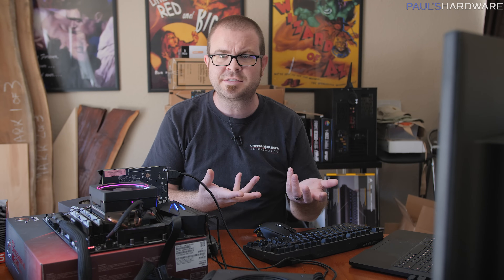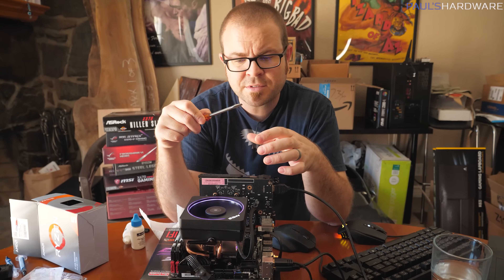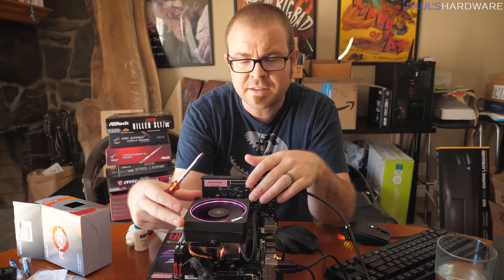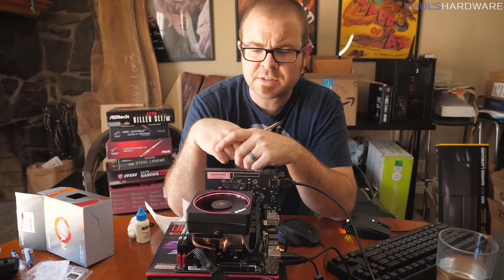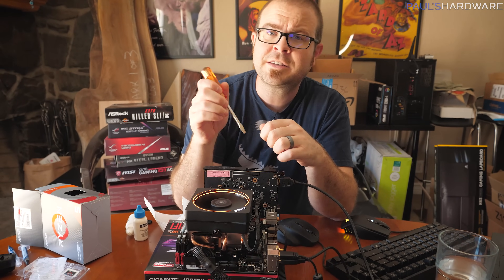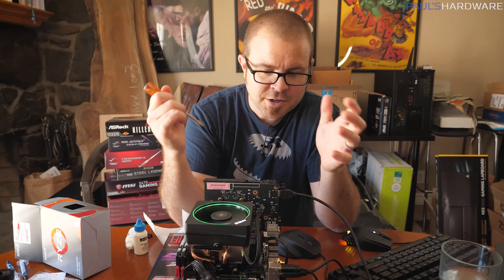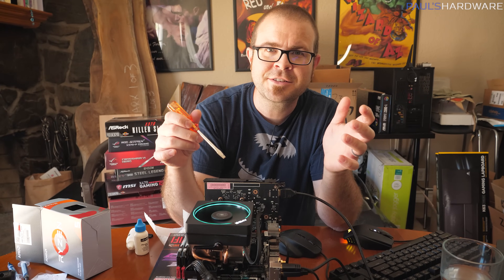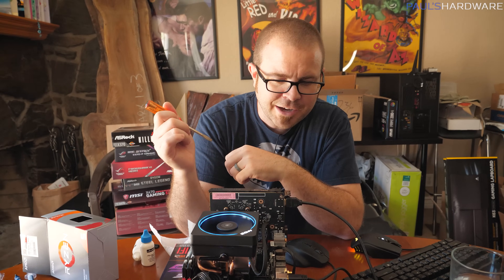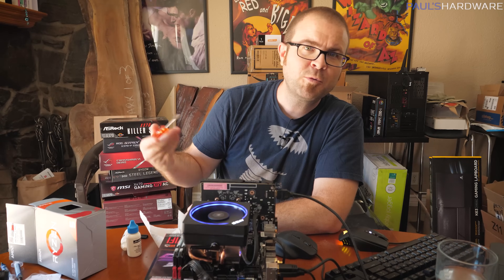What have we learned today? First, it's good to revisit things from time to time because I often overlook things I take for granted — such as using too much force when installing or uninstalling a CPU cooler. If you're snapping on one of those AMD CPU heatsink fans around the clasps on the AM4 socket mount, don't take a screwdriver and apply significant downward force towards the motherboard. If the screwdriver slips, it could knock off SMT components. I initially got no response from the board after doing that, and while wiggling the transistor I knocked loose got power back, I don't have high hopes for this board's longevity without some soldering.